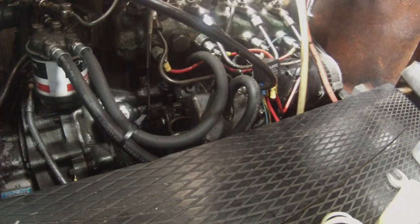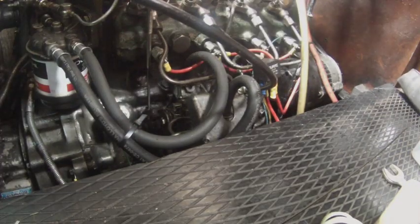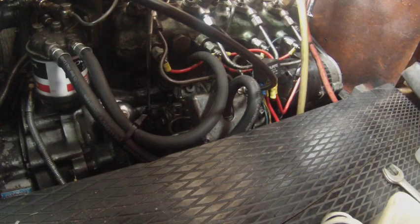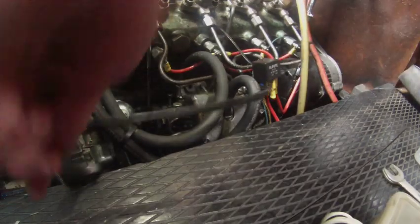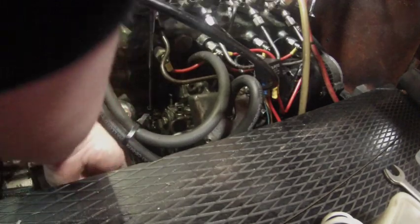On the 1.5 BMC engine, the pump is located on the side of the engine towards the rear — it sticks out 90 degrees from the engine block. On the 1.8, it's in parallel with the engine and more towards the front. It's responsible for delivering the freshly filtered diesel to the injectors. The suspected issue is that the pump could be leaking diesel into the engine sump, usually caused by the seals and workings of the pump drying out or wearing out. The only way to remedy the problem is a total rebuild.